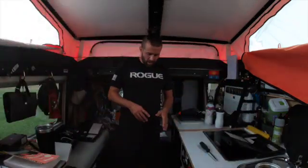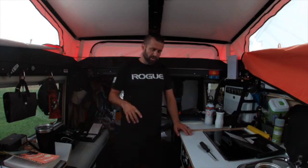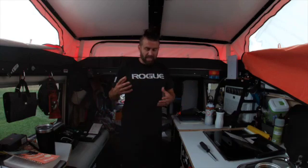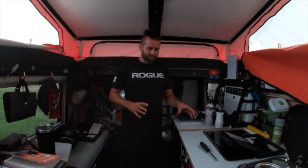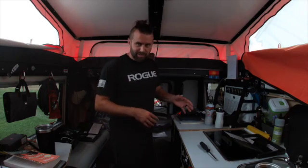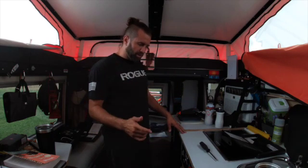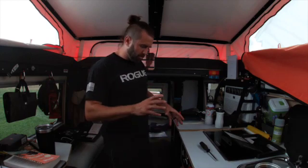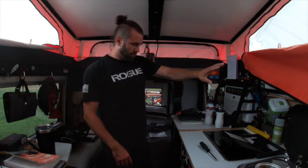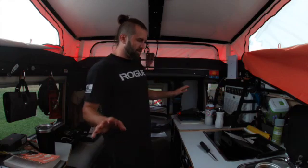I have the cover off of both units — new and old. I want to note: I'm comfortable doing this. I have 20 years in the field as a mechanic. For those of you who probably shouldn't be doing this install, take it to the dealer or an RV shop. Important steps: I'm disconnecting my 12-volt power with our battery cutoff switch, and I'm completely unplugged from shore power outside. Right now everything is dead in the trailer.